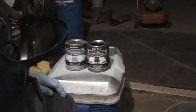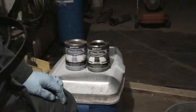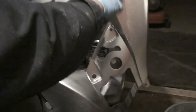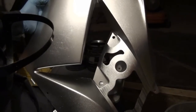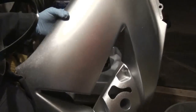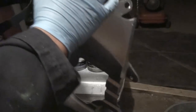I have already done some parts. Here is a silver piece that I've already done — I've already silver-based this. I still need to wet sand it down because there are some obvious flaws. I'm not doing it in a paint booth; I'm just doing a makeshift paint booth, kind of doing this in my shop here. I've already put my adhesion promoter down and painted the silver. What I have to do is sand it down, wet sand it, give it another silver base, and then I'm ready for the candy color.